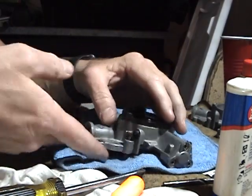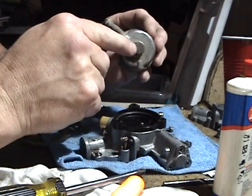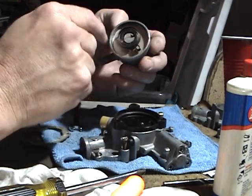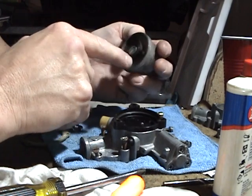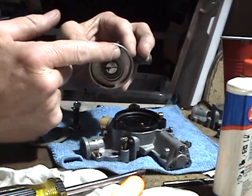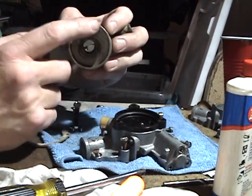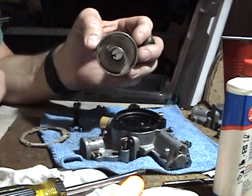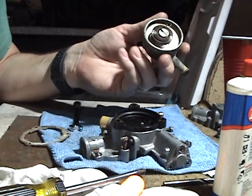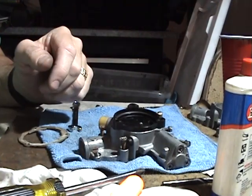I did take the heat mass off the other one and managed to get this nut off, which was extremely difficult. What I did is I boiled this whole thing and watched the spring to see how far it would go — how far it moves as it heats. Then I marked it, and that's where I set my adjustment to — just like John Twist says in his video, and it does work, by the way. So I'll get this all put back together, put it on the car, and hopefully it leans out my engine. Thanks.